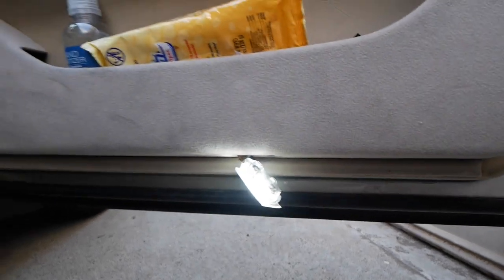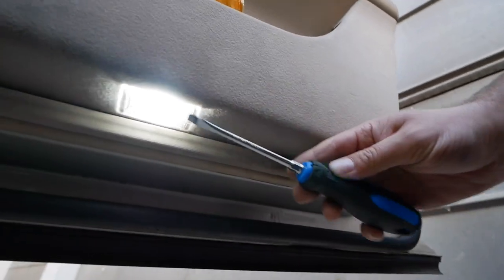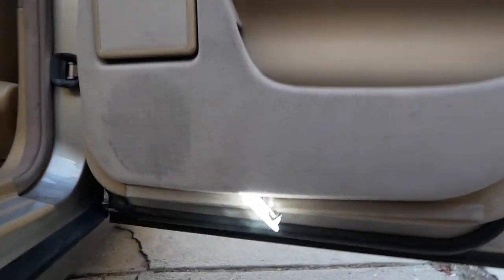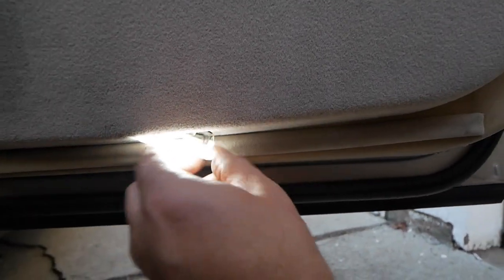I came outside for the door/pedal courtesy lights because there's not much space in the garage. These are simple to pull out — just find something to put your knees on so you don't hurt them. If a light doesn't work, rotate it 180 degrees. Just stick a screwdriver in and pry it out — works just fine. I did all three front doors on the inside. For the last rear door, the lights don't pull all the way out so I replaced it while it was still on — these don't have enough voltage to do you any harm.